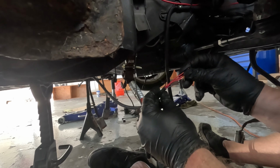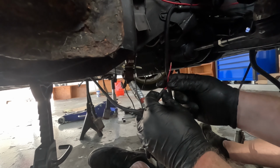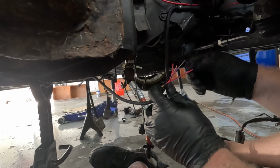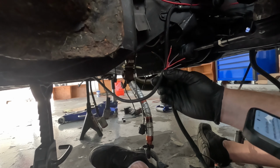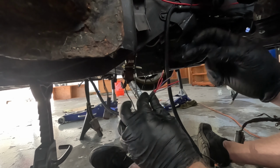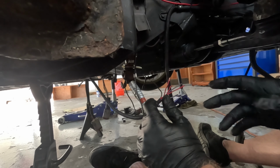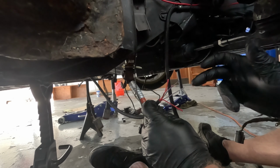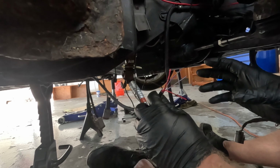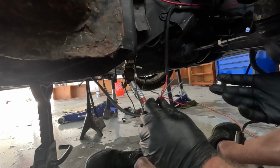Okay, so for the terminating ends of the Bowler all-in-one harness, we have red and black, which is power and ground. It's used primarily for the reverse lockout switch. And then there's also a purple, let's do purple, purple, yellow, and purple, white. So the purple, yellow, and the purple, white are the speed output signal wires. One of these comes standard with a 40 pulse output, and the other one is a 16 pulse output. It turns out, if I'm reading this correctly, you can change that pulse output on either one of these wires to be, I guess, whatever pulse output you want. Either one can be 16 pulses or 40 pulses, and you can change that through the app via the Bluetooth control module.